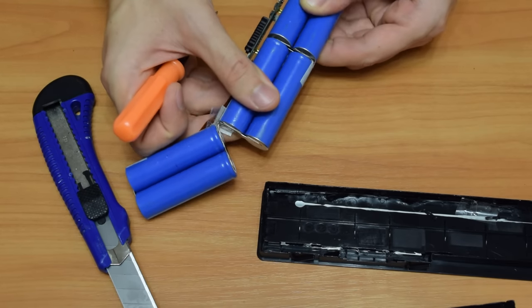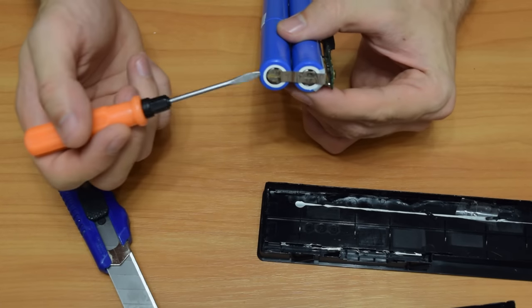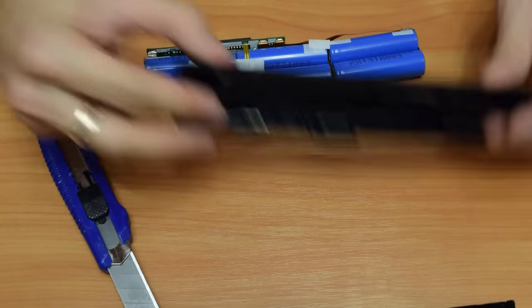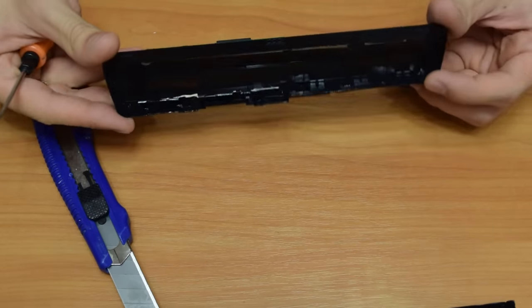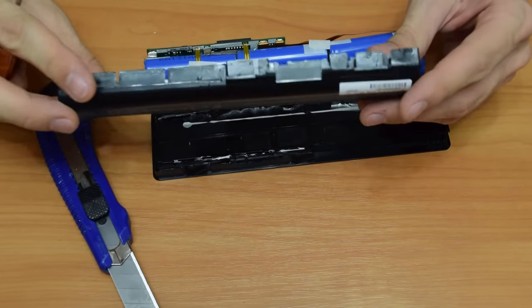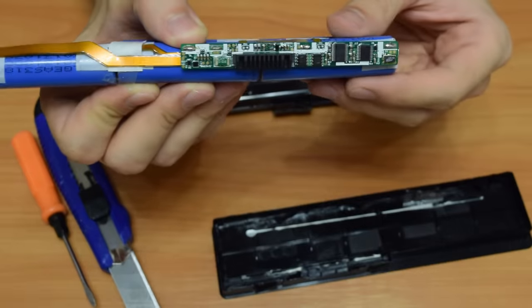If your laptop still charges the battery but it works just a few minutes, it's not too late to change the cells. But if it doesn't charge, apparently the charge controller is in protection mode, which means you need specialized equipment and original firmware to refresh it, or it's just a few steps to the trash can.